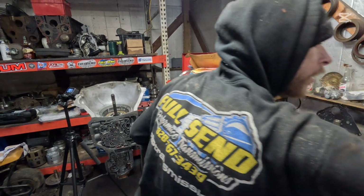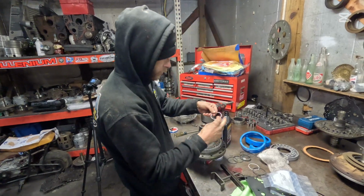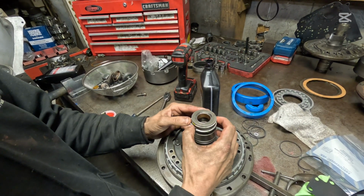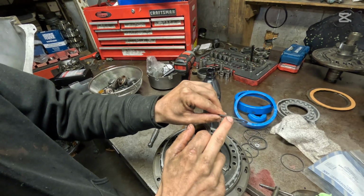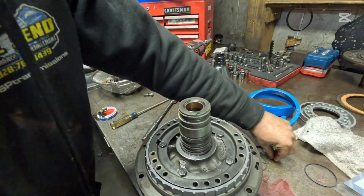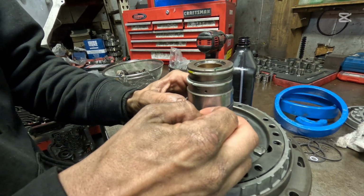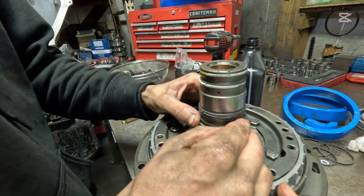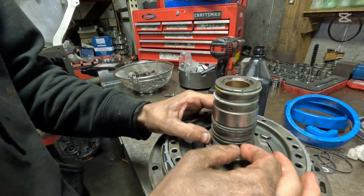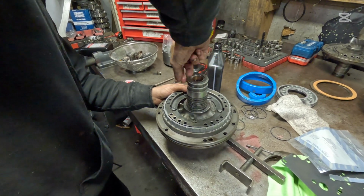We're going to find our sealing ring kits here. The white ones go on the top. There's 1. There's 2. You want to look for the green dot here. Walk this down. There's 3. And we're going to skip this one here because we're going to dual feed 2nd gear. Walk this down all the way to the bottom. Just like that. And we want to make sure we grease this up nice and generously on all of these. Make sure it goes in right, seals right.